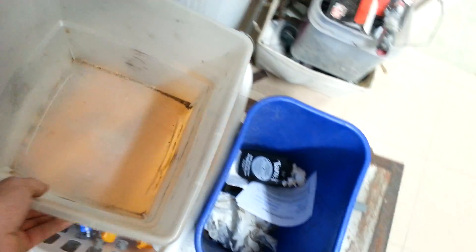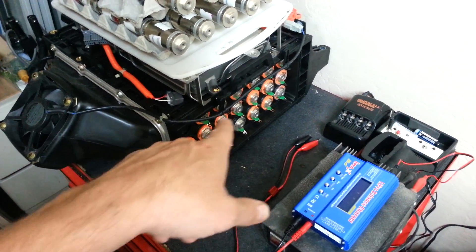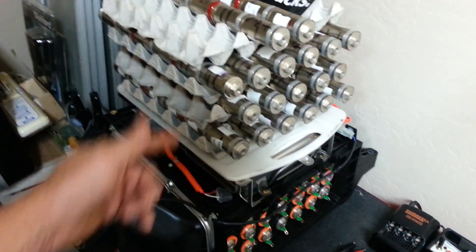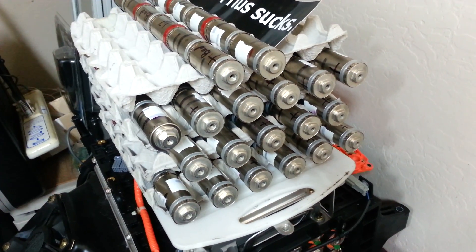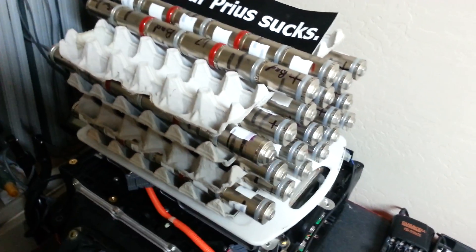So that's it, guys. These are all the old coverings that were on the sticks. I've got a pack in the car now and this extra pack here that I'll keep in the closet during the summer. I'll put a load on these sticks individually — maybe every month to month and a half — and recharge them with this little device to keep them good. These are spare sticks now. These little egg crates I stole from my wife work out pretty good for stacking your batteries: keeps them insulated, keeps them separated, and it's easy to put a multimeter to them. Thanks for watching — I hope this helps somebody out and gets their car going.